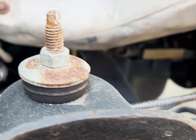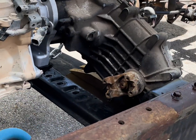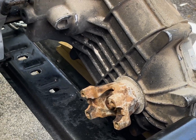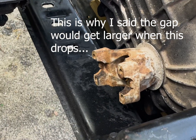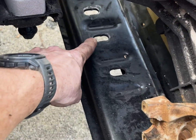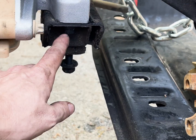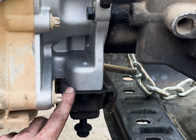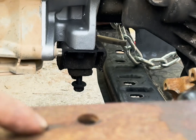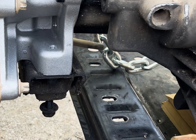The driver's side motor mount is in. Passenger side motor mount is in. Currently the transfer case is sitting on a shield down there, so this crossmember bolts in — it needs to slide forward to this hole about four and three quarter inches. We'll just have to widen these holes a little bit. This is the factory mount out of the Bronco, and it bolts right into this Atlas adapter here and drops right back into the factory crossmember. So we're just going to slide it forward and use at least a few of the factory holes in the frame.